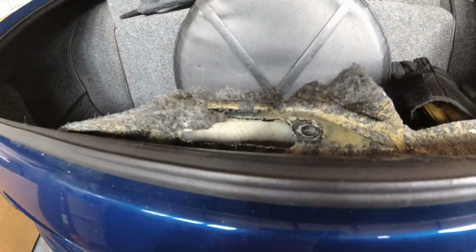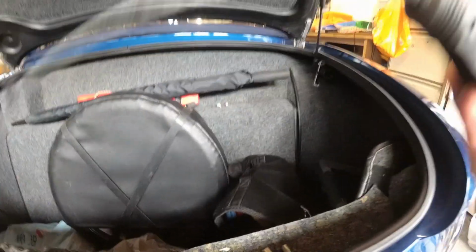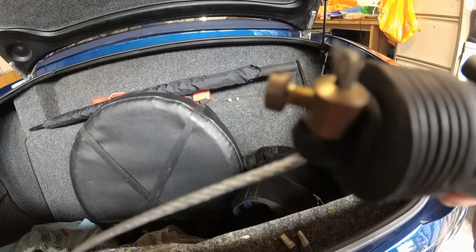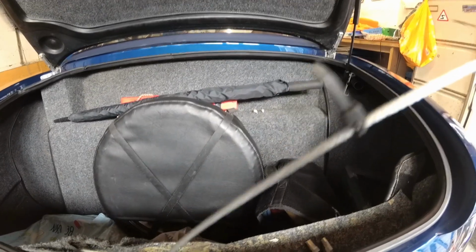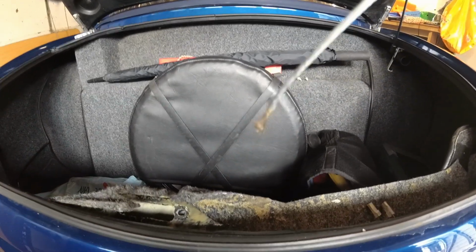Right, so the plot thickens. When I tried to put the wire in the new one, it really wasn't long enough, so I thought I'd find where the solenoid was, which is this. So the wire is connected on the end there. That wire goes along, there's a cable tie on there which I'll explain later, and then the latch would go on this end. So if you look at how it's laid out on the car, the solenoid is actually behind the carpet, behind a big hole.